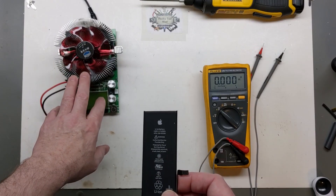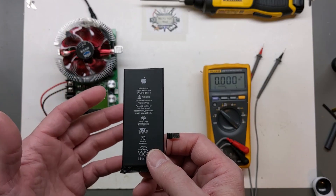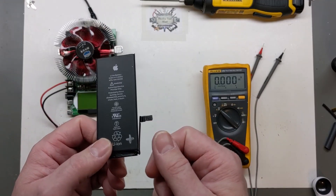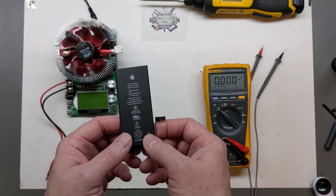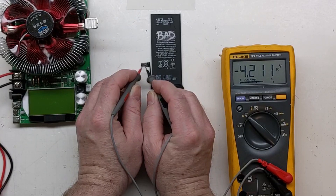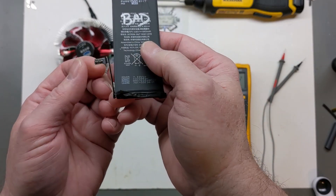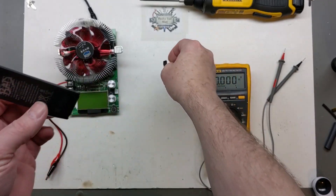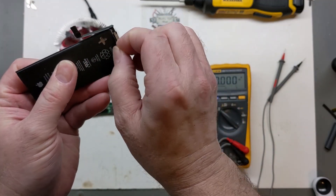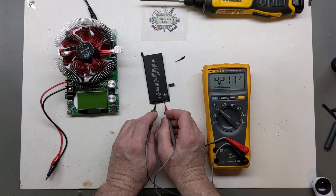Anyway, I thought I would do a video with my new load tester — a battery capacity tester. I just want to see what the capacity of these batteries are, because this one failed in a very common iPhone battery failure manner where it shows 80%, then the next thing you know it's showing 4%. You charge it back up and within five minutes it's showing 80% again — definitely dropping off kind of quick. So I fully charged this thing and we have 4.2 volts. We peel this little end off, and we should have some black tape on here — and we do. This should be our positive side; I already checked this to save time on video.